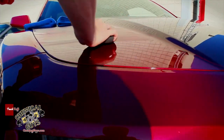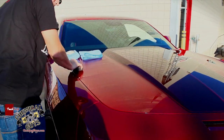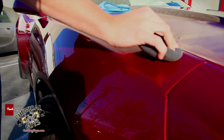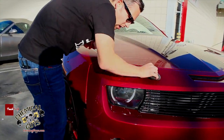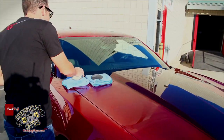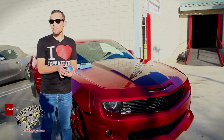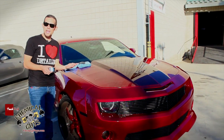It's always good to go back and get a little bit more wax as you apply it to the surface. I'm going to go ahead and do this fender as well, right on top. I changed up — I went from a horizontal manner to a vertical manner — I want to make sure I get a great look all over the vehicle. 50-50 is an extremely refined paste wax that goes through a long curing process, and in that process it actually requires a 20-minute dry time. Other waxes might be wipe on, wipe off, but to get the best result, we choose to wait 20 minutes when applying a paste wax to any car.